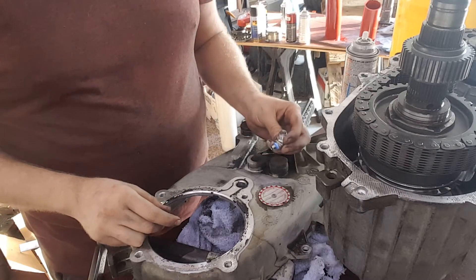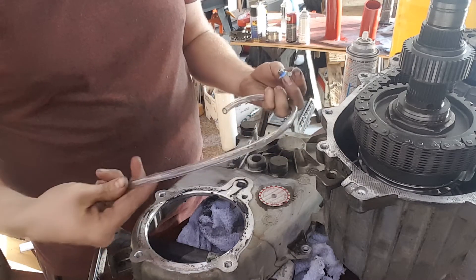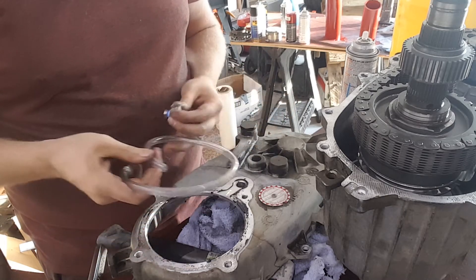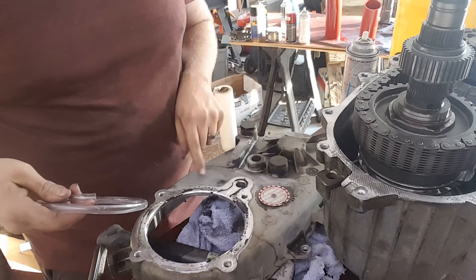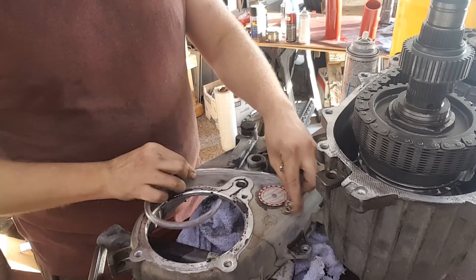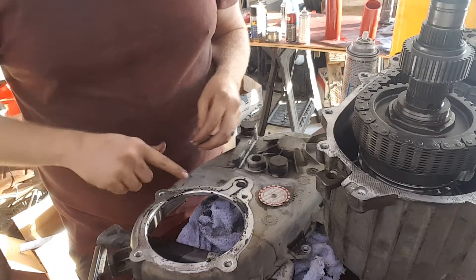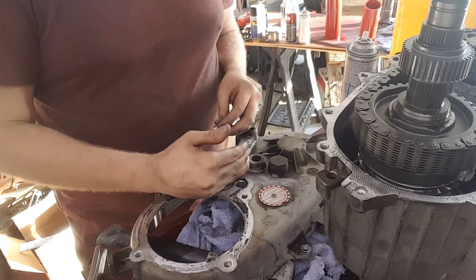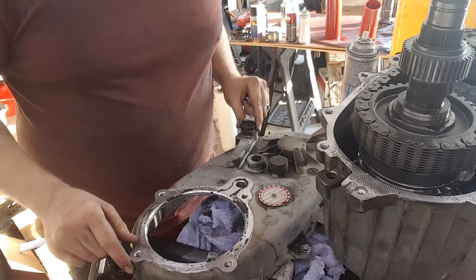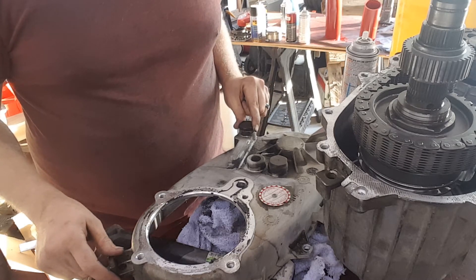What I'm also going to do today is add a sight glass or a sight tube to know what level the oil is inside the transfer case. I'll put a hole probably up here and probably down here, and it'll just sit kind of like that. While I'm wheeling, if I ever have a problem or just want to check, I'll climb up under the truck and see the fluid level. I don't think I'll have any issues with that, but I'll get this started and come back.